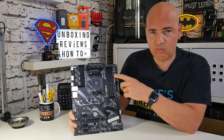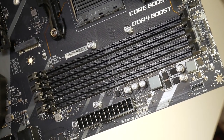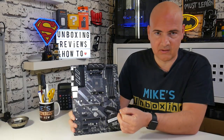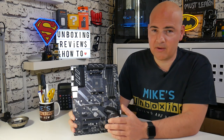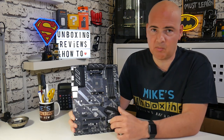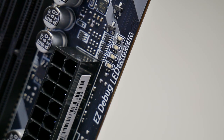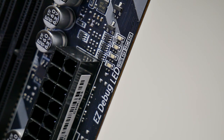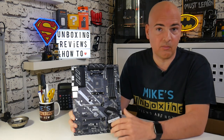There are four DDR4 RAM slots supporting up to 128GB — more than enough for now and well into the future. You can install 32GB in each slot for 128GB total. Memory speeds range from as low as 1,866MHz up to 4,400MHz in overclock mode, and that may increase further as BIOS updates become available. There are also four debug LEDs — if your system isn't booting, you can check these to see whether the issue is with the motherboard, processor, graphics, RAM, and so on. Really helpful for both novices and experienced system builders.